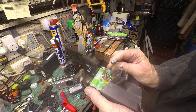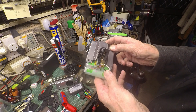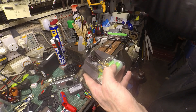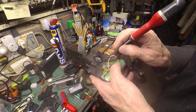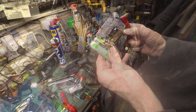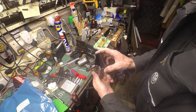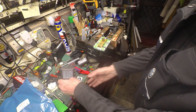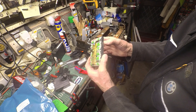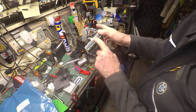Meanwhile, another T8 Torx screw, a bit of circuitry, and the main power connectors back up to the vacuum, with a very neat looking array of cells. That was just held on with a bit of the stickiness of this strip down here - there's a foam strip down the side with this shiny plastic outer, which in normal manufacturing would just slide in very smoothly, and then the outer cover just clips on and picks up on these catches as a one-time closure.